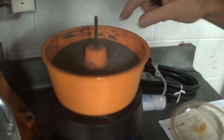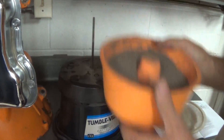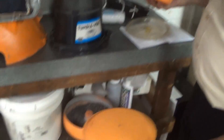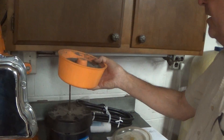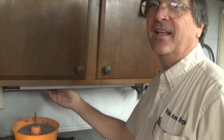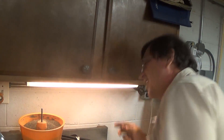You change these containers. This green stuff — you add water — it's aggressive. It's plastic with a grit mixed in, for rust removal. The other media is for polish — it'll still leave pitted rusty ugly metal, but it'll clean all the ball crust off. And what's this? A Mopar 727 TorqueFlite — that's correct!